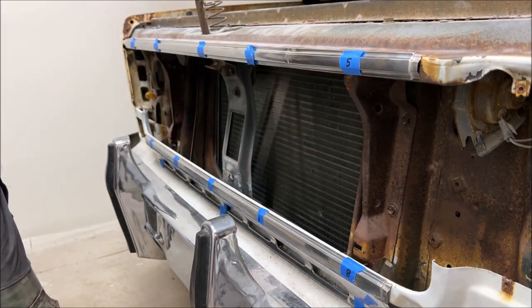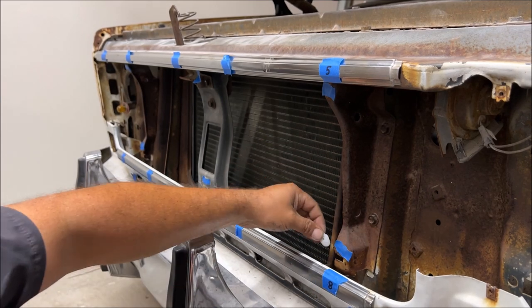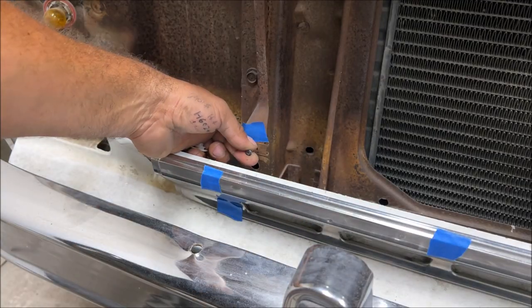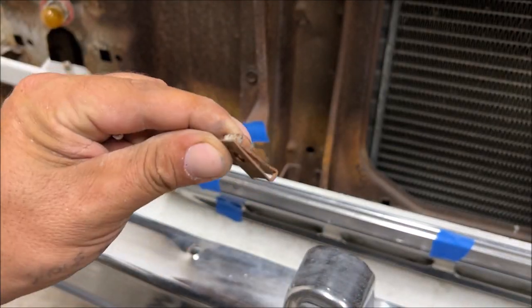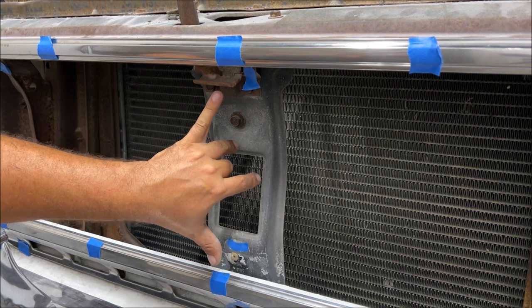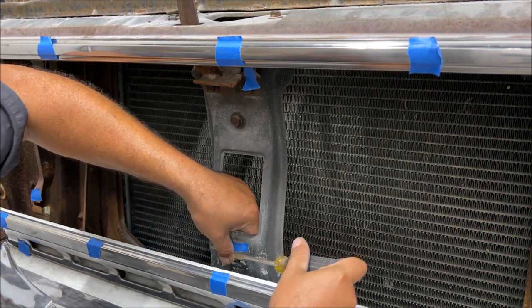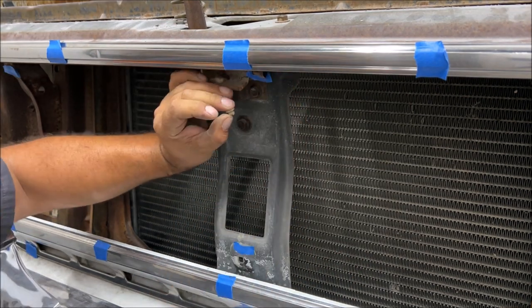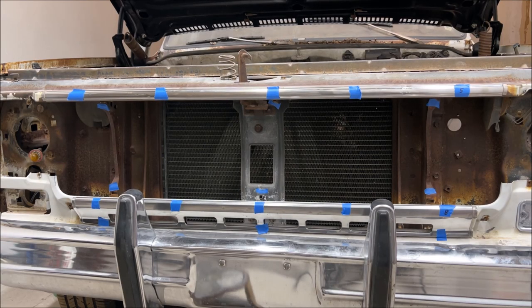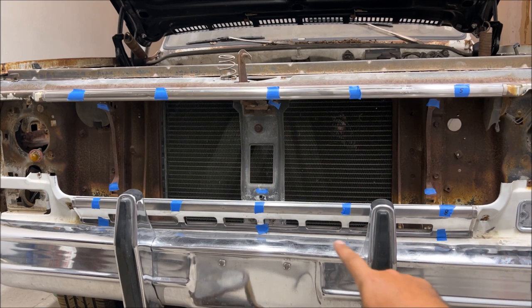We have six pieces of blue tape where your clips should go. This is what the actual grill clip looks like — it just had some random Phillips screw with a clip; that's not correct but it works fine. On the center two screws of the grill it uses a smaller little square clip. Get these out and replace them. I'll have a link in the description and end screen to my grill restoration video — go check that out to see how I cleaned the little clips up.